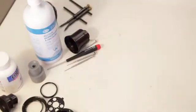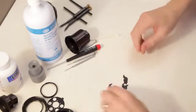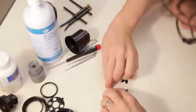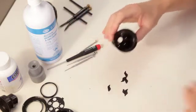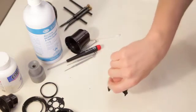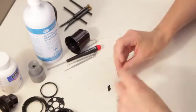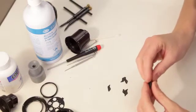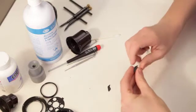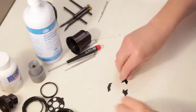We're gonna dry these off. I just dried these off. I'm gonna be stacking these clockwise. What you wanna do — I'm gonna show you because I can't show you down inside the barrel — they are going to be stacked. This is the toughest part about this lens. Don't strip that screw on the side that we took off. They're gonna be stacked on top of each other. Because you're kinda blindly dropping them in, you're gonna take a screwdriver — they have little tabs. It's easier to use a magnetic screwdriver. You'll just maneuver them into place, then put your finger on it and pull the screwdriver out. They're gonna be stacked going around in a circle, on top of each other.